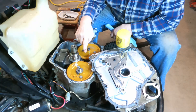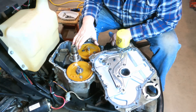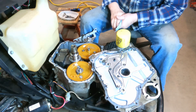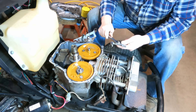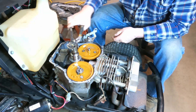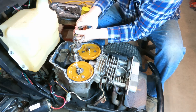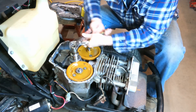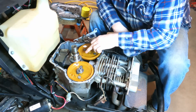That looks to be intact. These are the cams — you'll notice the cams have IN on this side and EX on that side. If you ever take those gears off, what you should do is turn the crank so that these index marks line up with those two marks. I'm going to take the spark plug out — with no compression it'll be easier to turn everything. I'm going to try and grab it with these channel locks. I don't know which way this rotates, but I'm just trying to get these wheels turned around to the right position. Right about there ought to do it, so now if I want to take these gears out I can, because I have these lined up.